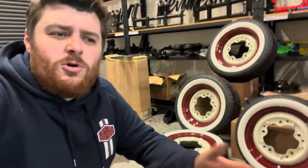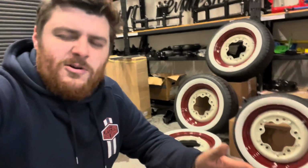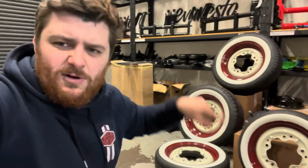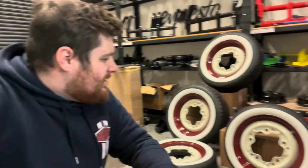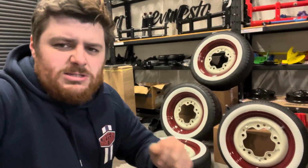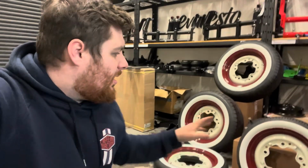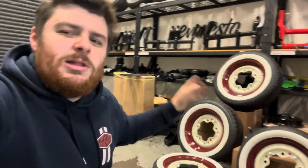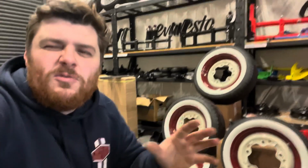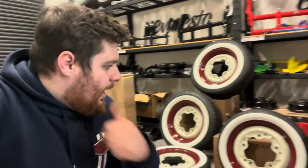You know, 4-lug smoothies, you can get them off the shelf and that. I personally don't like the look of them too much. I prefer the sort of wide 5 stud pattern and the proper dome hubcaps you can get with VW logos in. So yeah, we're converting this to an early style stud pattern in the process of fitting these wheels. These are a 4.5 at the front and a 6 in the rear. So a little bit wider in the rear, but not too far. You know, kind of a good fitment, but not a stupidly wide fat fitment.